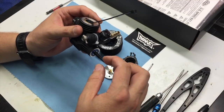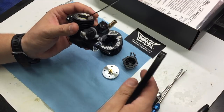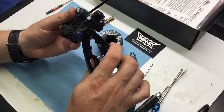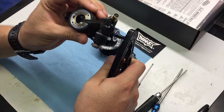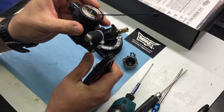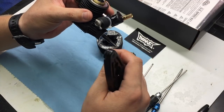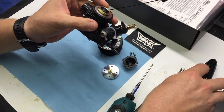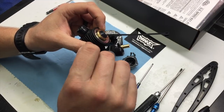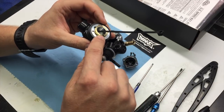You can do this a couple of different ways. You could put your clutch nut on the crankshaft and just start to turn it over. What I like to do is use my Protech shock shaft pliers because I know it's not going to gall or scratch the shaft. You'll turn to where it starts to put pressure on the zip tie, and then just turn it — but you don't have to turn all the way over because you can end up cutting the zip tie. You just need to get to where there's enough room to get your fingernail or your tuning screwdriver underneath the sleeve.